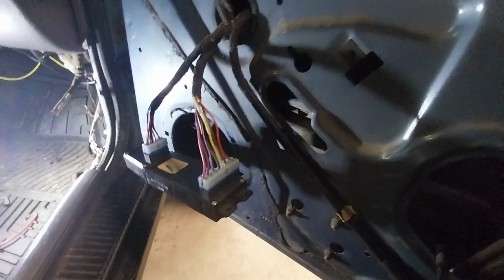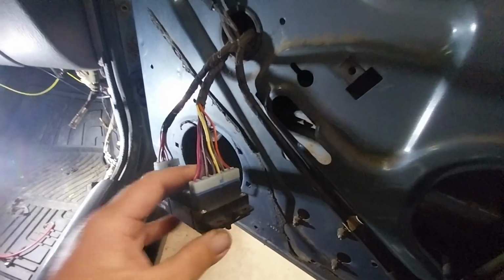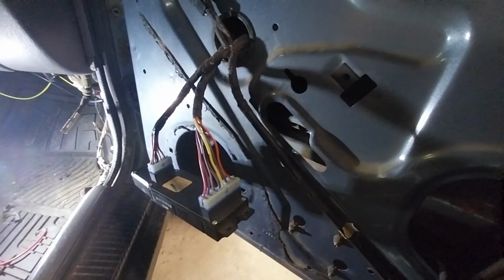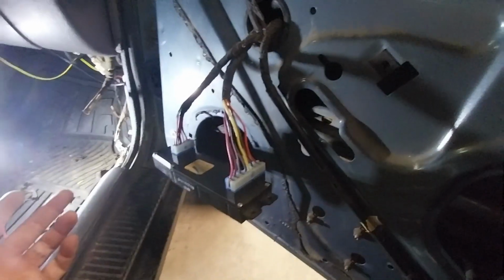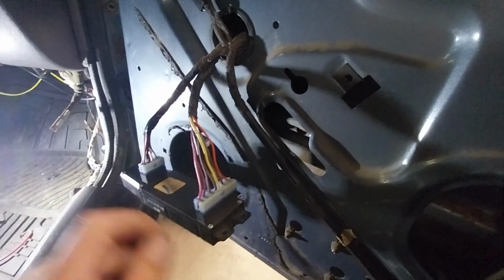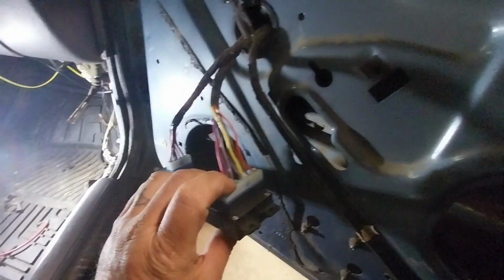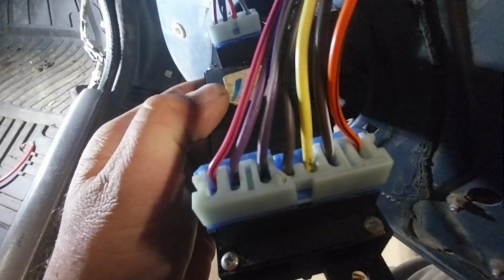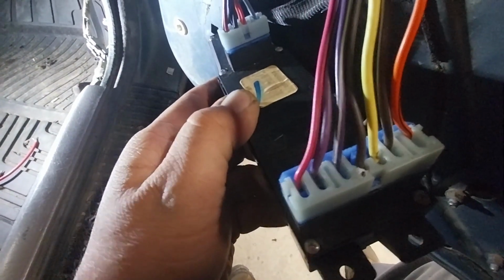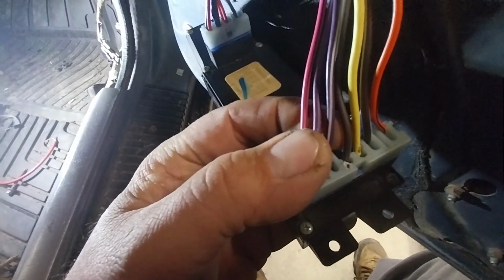And as I was probing it with my power probe, it was giving me a negative signal. It was just really weird. So I decided to give it negative ground through my power probe, and everything started working. I was like, what the hell? And when I was doing continuity checking back and forth, that wire was having an intermittent signal on the continuity of my voltmeter. I took this plug apart. See, I burnt a little bit of it because I was applying ground to it and it was getting hot. I took that plug apart, cleaned it up, and I ended up pushing that brown wire down harder into the connector. And that's what did it.